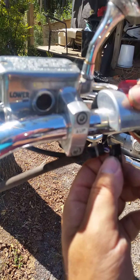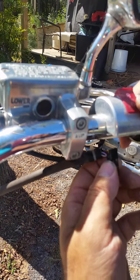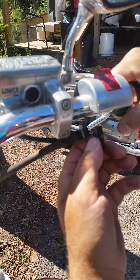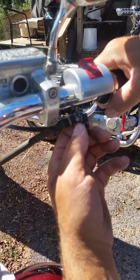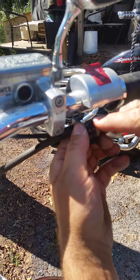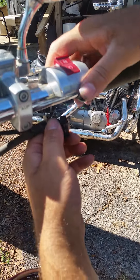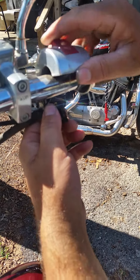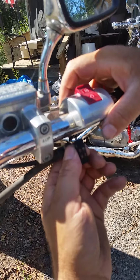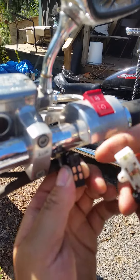I've been having a problem — my horn's not working, my headlight went out on me, came back on its own, then went out and hasn't come back on yet. My start switch is still working but you press it and there's a pause, then it grabs and starts. So I'm thinking it's about to go out anyway. What I'm gonna do is just clean this up real good, clean up these contactors, and put it all back together.